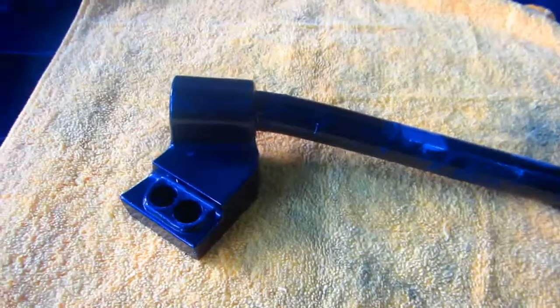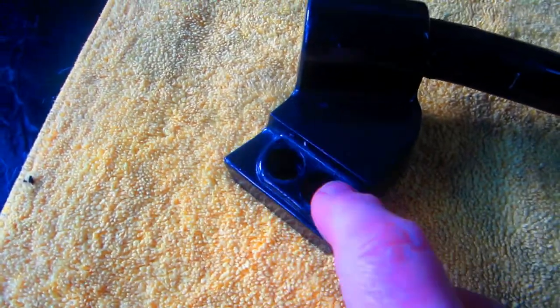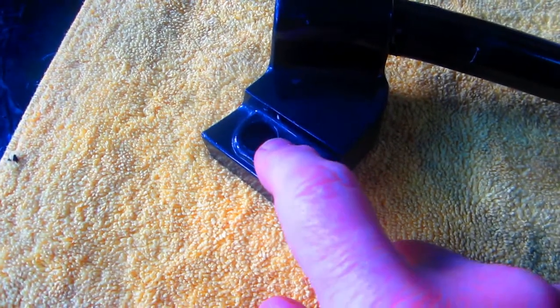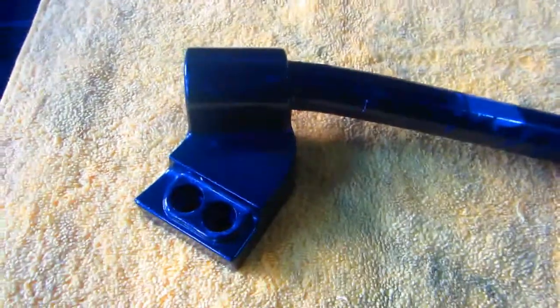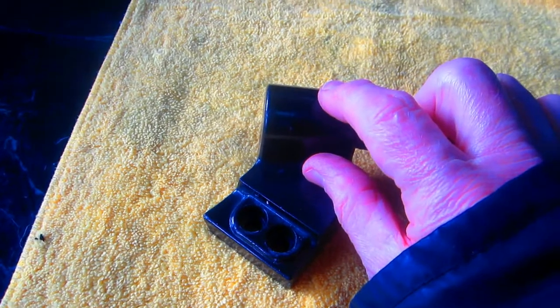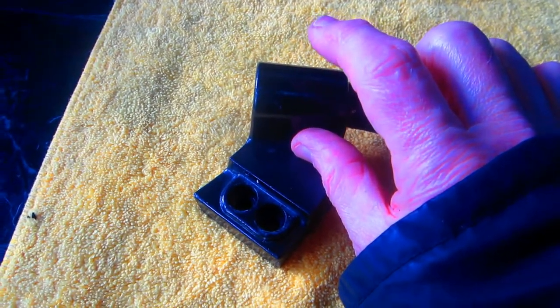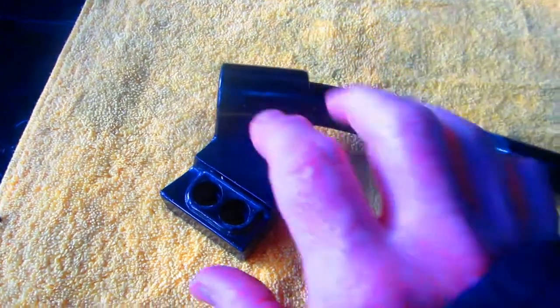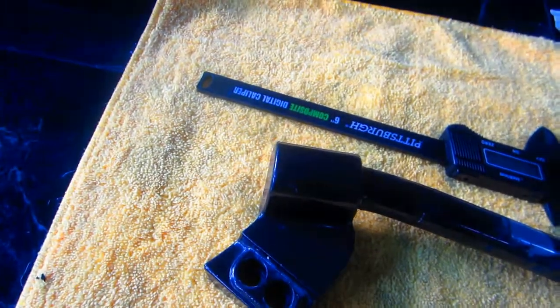So here's the spare parts off the track bike, the spare bike I should call it. Number one, if the holes don't line up, it's not the end of the world, because I could move the holes, I could machine this a little bit, there's a lot of things I can do. But here's what I'm trying to decide, if it's the same. And this part, visually, the last time I was up by Luciano's, looks an inch higher, but I don't know if it is until I measure it. So I'm going to make sure I take my caliper so I can actually measure how high that's going to be.